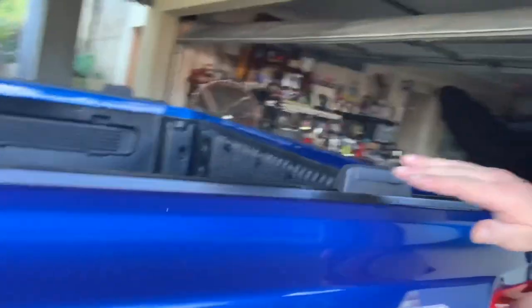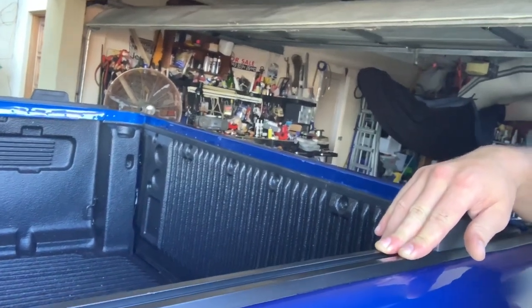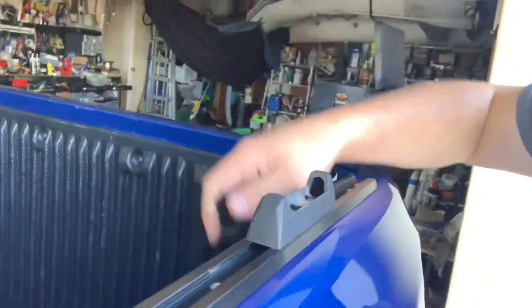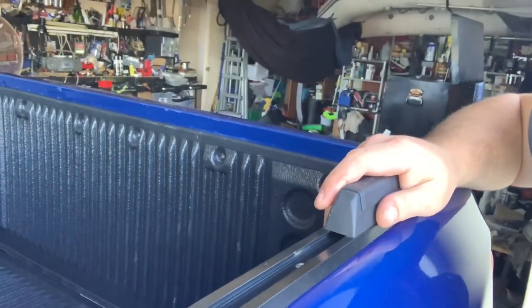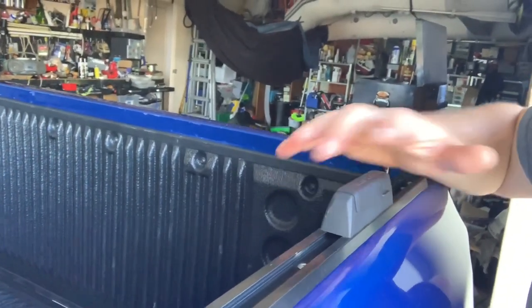And the way that works inside the vehicle — if we come up here — I've got these rails here which are I think an RT14. They're your sort of stock standard flat rivet-in rails, so you can see they're all riveted along here. Then the base of the mount sits there, so if you take that cap off that's where it sits in and that's where the pin goes. It's a fairly easy system to take on and off — quick and easy, an easy solution to put on a rooftop tent for a weekend away and then take it off so you don't constantly cover up your back window.